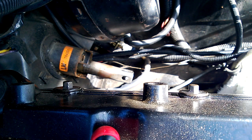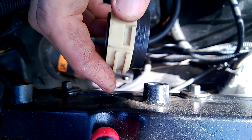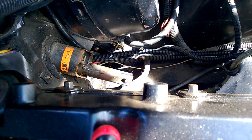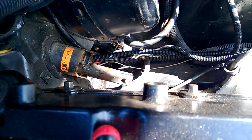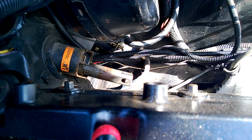Here's the comparison of the two. What I'm going to do is put some grease on the shaft — as you can see the shaft is now unsupported and it's real sloppy. I'm going to put some grease inside there. I'm using synthetic wheel bearing grease, which is probably way overkill, but since this is probably never going to be opened up again for any reason, I figured I'd put some good grease in there. I'm not going overboard with the grease either.